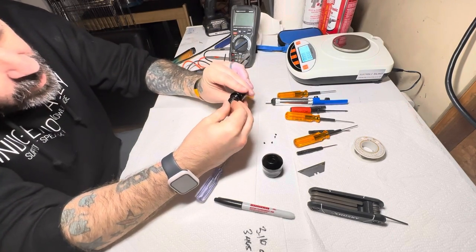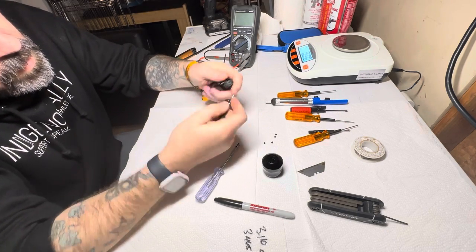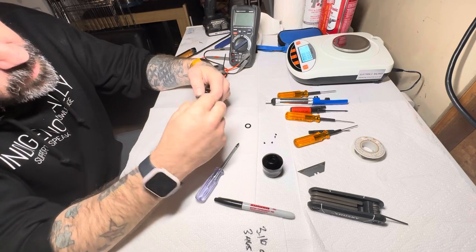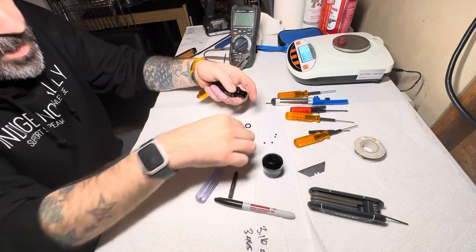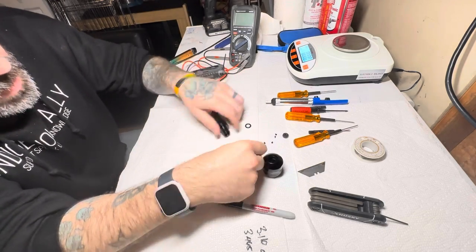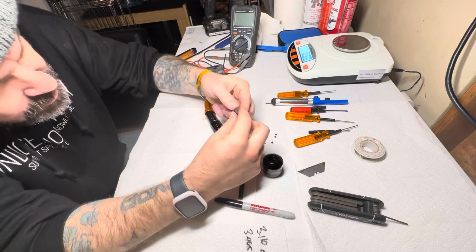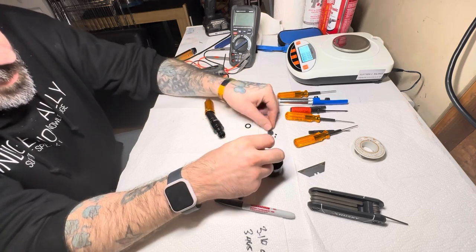This looks like an O-ring right here. Yeah, that's just the splash plate. Okay, so this should, especially because this is blind taking it apart. A little bit of grease, looks like a simple, look at that. So there's a single push rod that's coming down quite straight through the center of that. That's actually really tidy. Small O-ring on the back there, greased up, very light contact coming through the inside there.